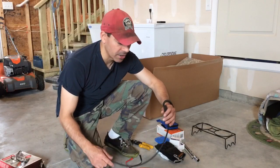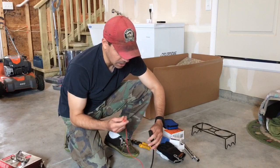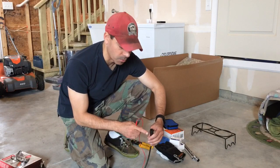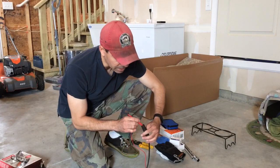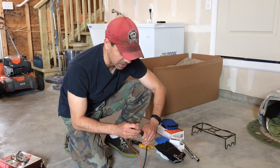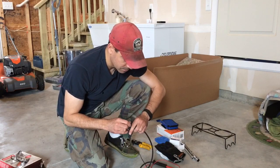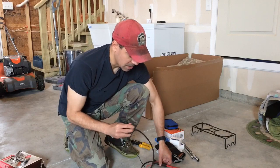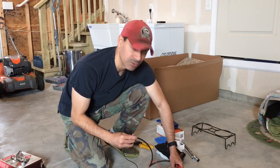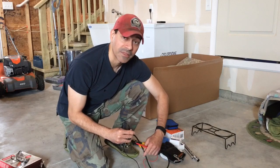Get your first spark plug wire out. You're going to take the wires from the multimeter and touch the metal connectors inside the actual metal connectors of the spark plug cables. Make sure you get a nice tight fit so it's an accurate reading. Then get the other end and do the same thing. Now look at the multimeter to see what reading you're getting — that will tell us the ohms by the thousands, and from there we can calculate by footage.